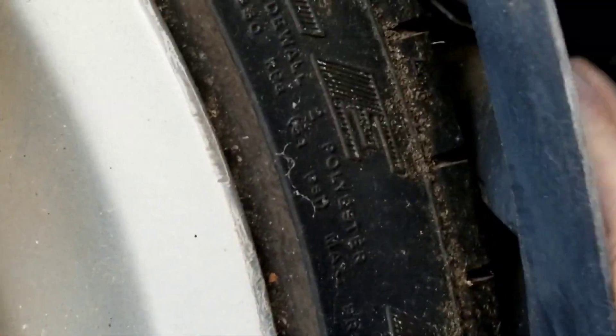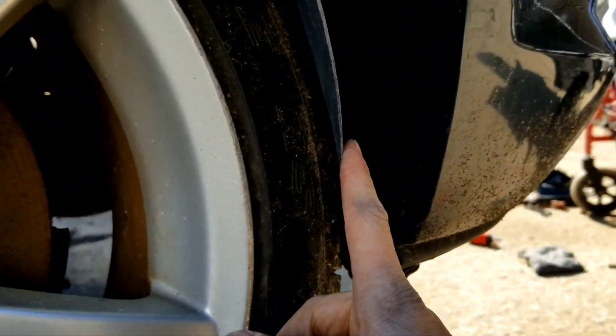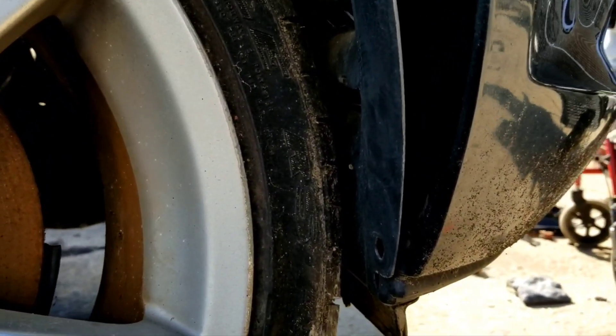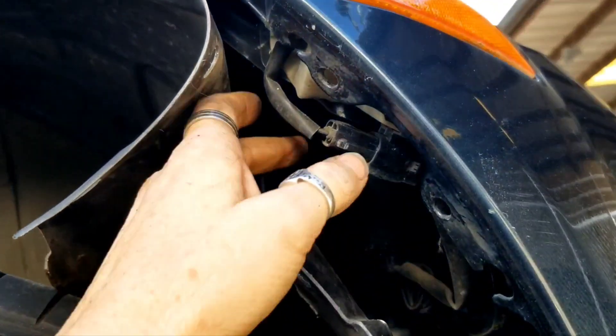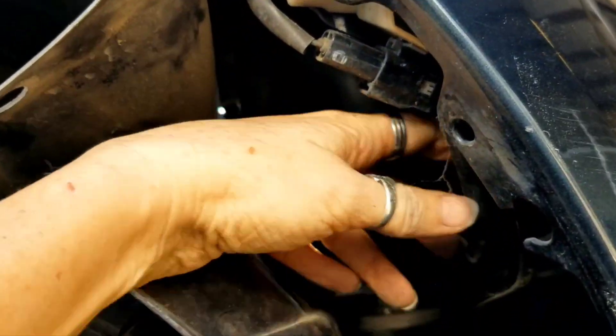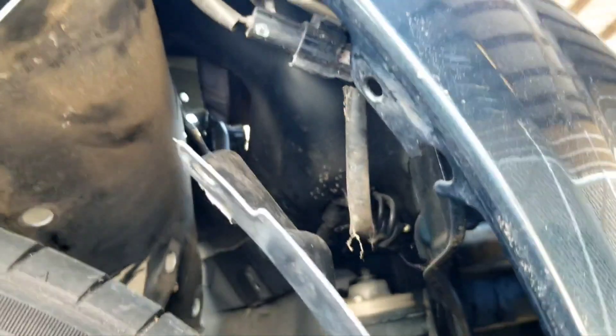I've removed this little beast, and that whole bumper is getting a lot looser. I'm going to go do the same on the other side and see if that doesn't free us up. I'm pulling this and I'd rather get the whole thing as one big assembly, just in case - this is for my mother's car - in case she ever gets in a wreck. Also disconnect your wiring for the turn signal, because it's going to be attached to the body. See here's where it's attached - disconnect this to also free the bumper up to remove it.